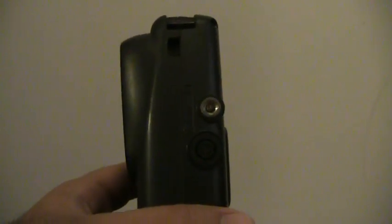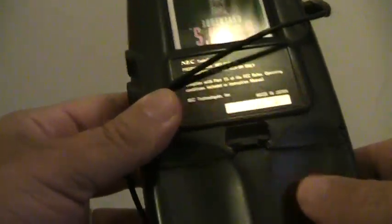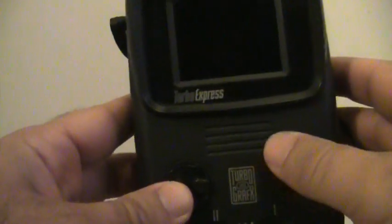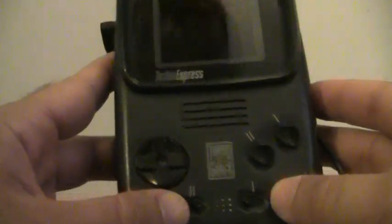It's a very big unit. On the side you have screw-ins for the TV tuner, kind of like the Game Gear came out with one as well. You've got your standard buttons just like the TurboGrafx-16 controller, volume, brightness, and an earphone jack. A downfall is the batteries — it took six double-A batteries but they only lasted three hours of gameplay. The sound quality also went out really fast on these; on this unit the sound is very faint. It will work if you plug in headphones, and some pixels would go out too.